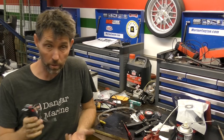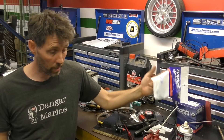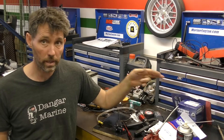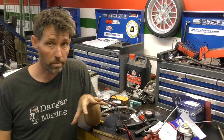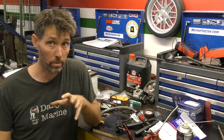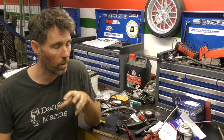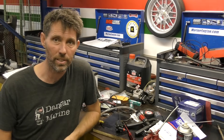Alright, well thanks for watching — I hope this helps you if you're having trouble or want to service the primer on your outboard. We've got plenty more kits to go through with this particular outboard: a carburetor kit, a fuel pump kit, a water pump kit — lots more to do. I'm going to continue disassembling the lower unit. I was actually planning to do that today but I need to find the right size threaded rod to pull the bearing carrier out, so I'll grab that during the week and we'll push on with the lower unit next week. Take care and I'll see you soon.